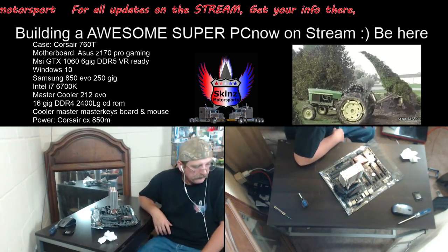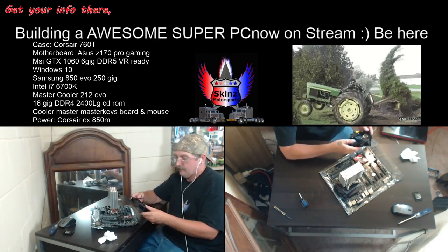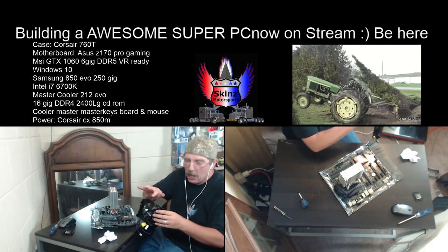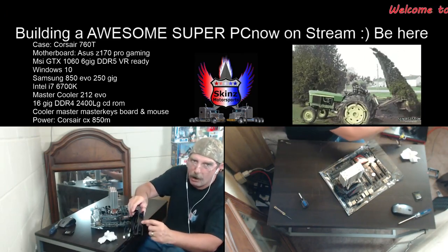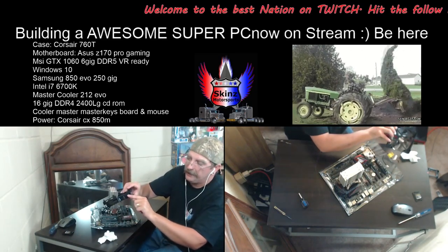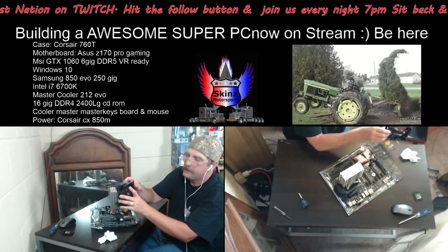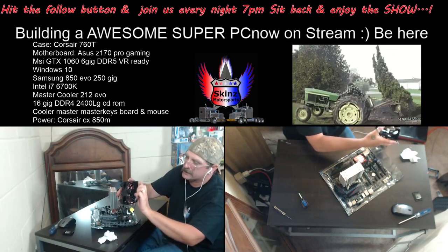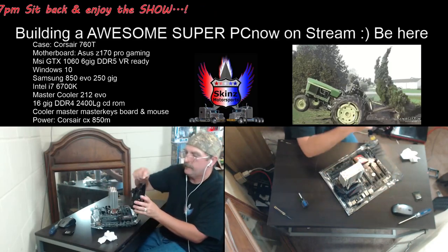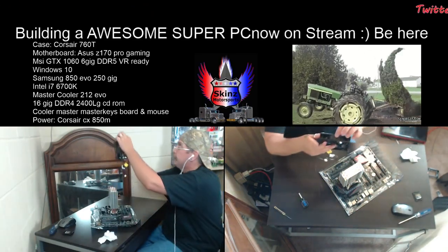We're working with this component. Z fan. Alright. Now we want to take the fan and find out somewhere on here it shows the flow. There's an arrow that shows the flow of air, and the turning direction of the fan is going to go this way. So if you hold your hand out here, if you spin it that way, the air is moving this way, the direction of this arrow right here. Everybody see that?